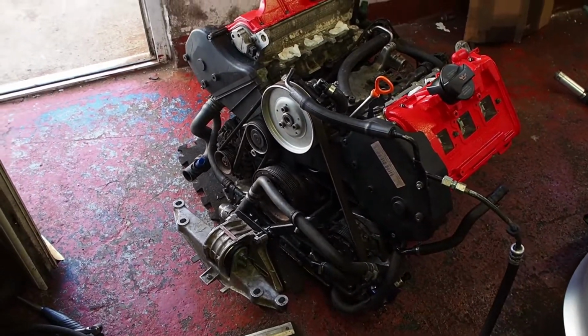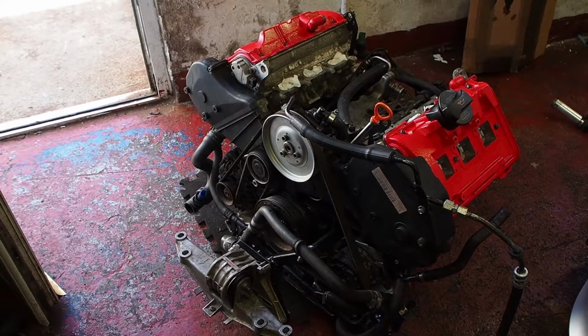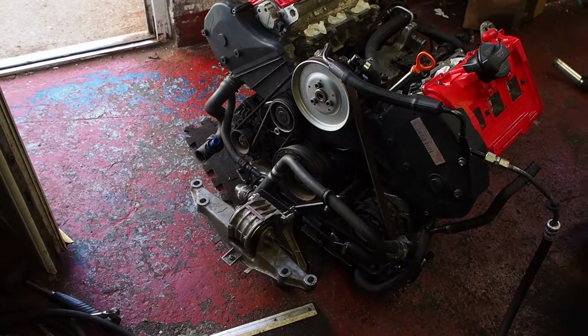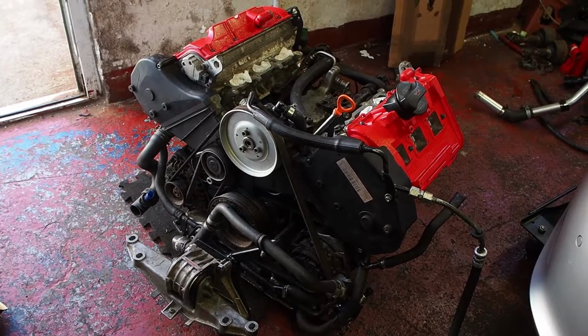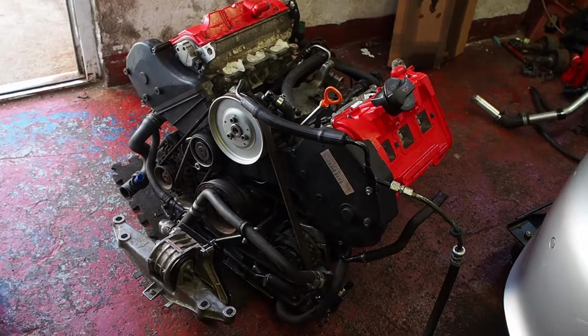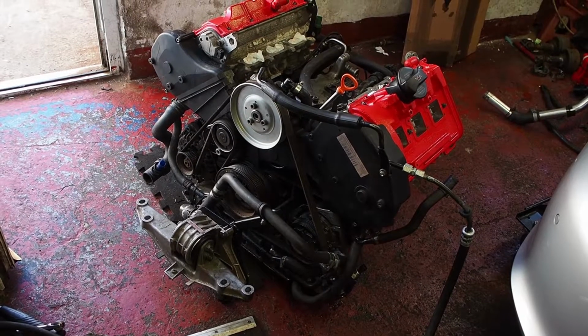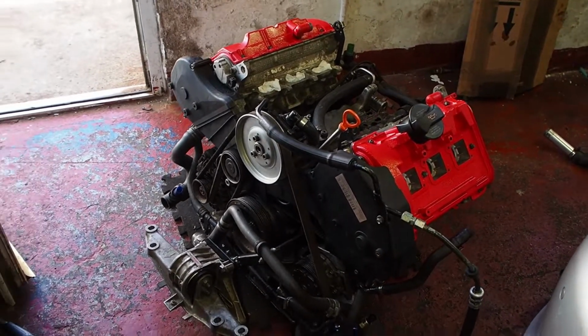It was definitely worth taking the engine out, because I found the cam tension had failed. A bolt on the thermostat housing had pushed through the block, and so there was oil potentially leaking from there, which you'd never find in the car trying to diagnose an oil leak.